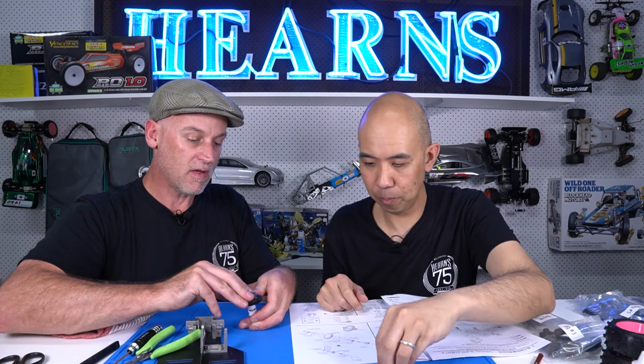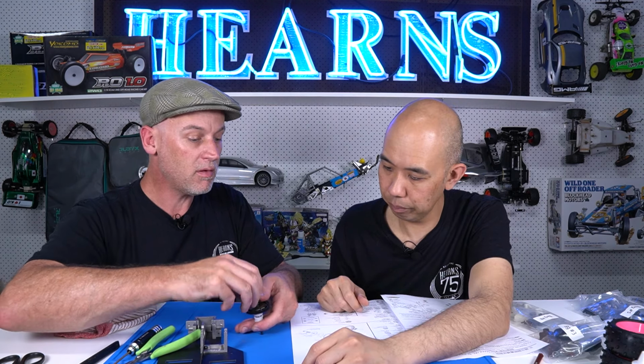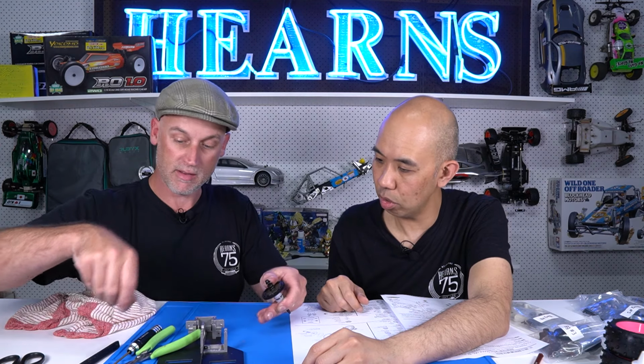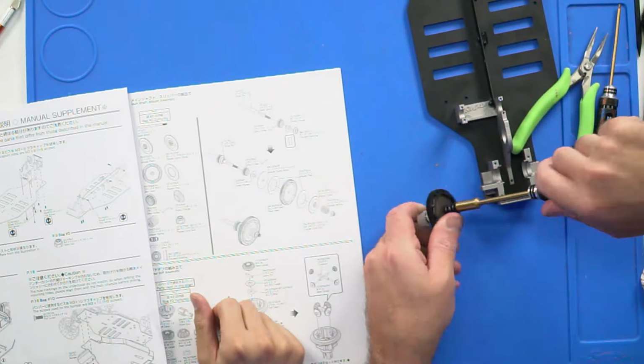Plate. Oh, you know what's going to look cool? The optional vented one. Is there an optional vented one? Yeah. Optional vented one off the YZ2, but Slavin's got one already on order. There you go. Is there another collar on there? No. No collar? No. What do you mean? No collar. Straight on the spring? Straight on the spring. Wow. I am befuddled. You're going to have really strong fingers to hold that in place. Why? As you tighten it up, your lay shaft's going to want to spin. It's only a nylon. Yeah. You got strong fingers. Probably not that strong.